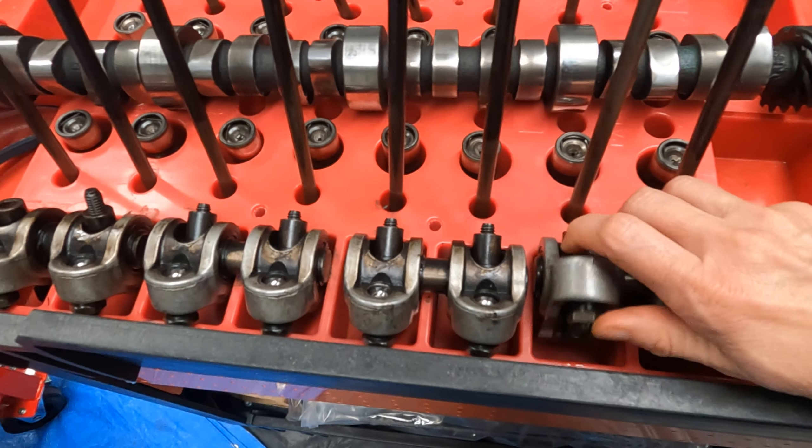As it turned out, there was no wiggle — there's a really nice tight fit and also a very smooth spin of the cam when it's in there. For the end float, we measured that with feeler gauges just to get somewhere in the ballpark. For this Holden engine, Holden recommend end float somewhere between 2 and 14 thou, and we got smack bang in the middle of that with 8 thou.